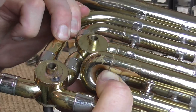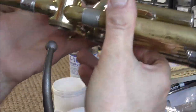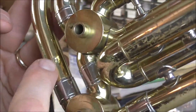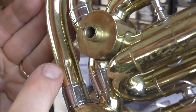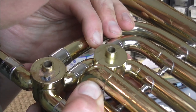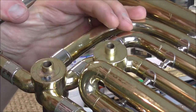It is coming out a little bit. It came out a lot. I am going to take that off. The mandrel did twist a little bit while I was doing that because of the force on it. The dent is most of the way out — it is better than it would be if I were to go in with a dent ball. It is still not perfect, obviously, but it is pretty good. I am going to straighten out the mandrel and then do it one more time to try to finish that dent up as good as I can. Actually, I think I am going to stop there — I probably will just do damage if I keep going. So I am going to be content with it the way that it is.